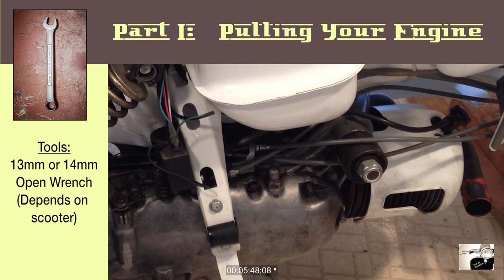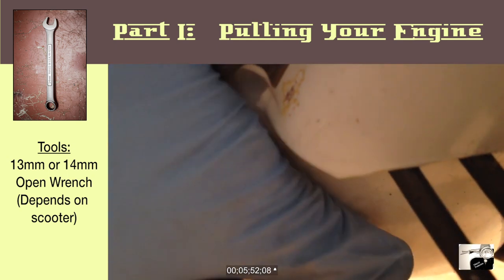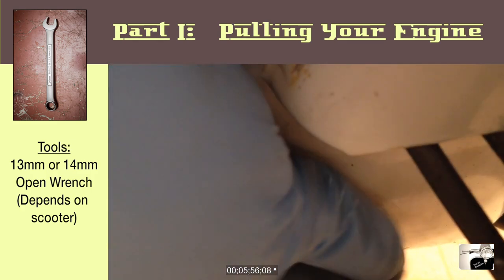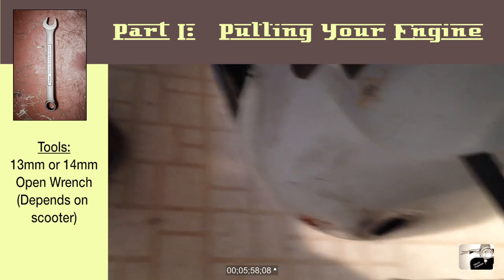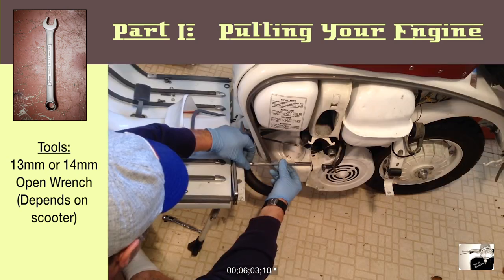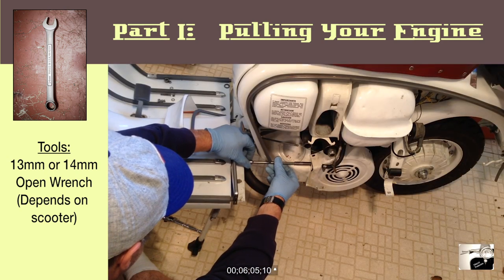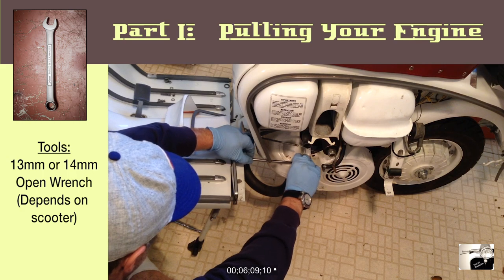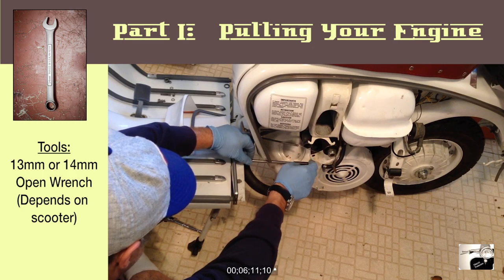In this next step, we'll start by removing the bolts that hold the cylinder shroud to the cylinder. Start with a 14mm socket wrench and unscrew the bolt attaching the shroud to the head. Next, find the two smaller bolts that hold the shroud near the carburetor end and unscrew these. While this won't fully remove the cylinder shroud, it will leave it loose enough around the head that you'll be able to access the two bolts needed to remove the U-Bend.